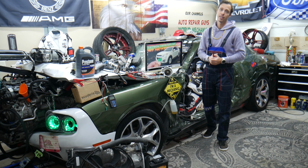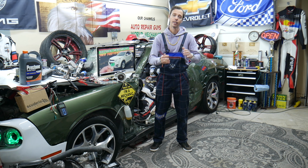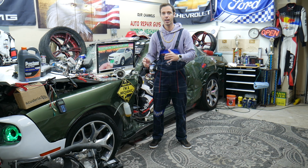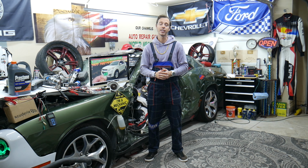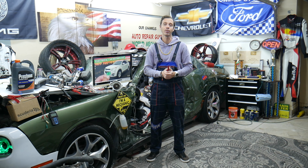Another thing, you hope it's not your case, guys, it could be a mechanical problem with your engine, such as a blown head gasket, cracked cylinder head, or cracked engine block. It's more common to have a blown head gasket than any of the other things that we mentioned. For the symptoms and signs of a blown head gasket, we'll have a video on the channel that will explain that. You hope that's not the case, because you have to remove the timing chain, take the engine apart to remove the cylinder head, have the engine block and cylinder head resurfaced or checked for cracks, then put on a new head gasket and put it together, and that could be quite an expensive repair, guys. But we just hope that's not the case. That's why you don't want to keep overheating it, because eventually you will blow your head gasket and damage your cylinder head as well.